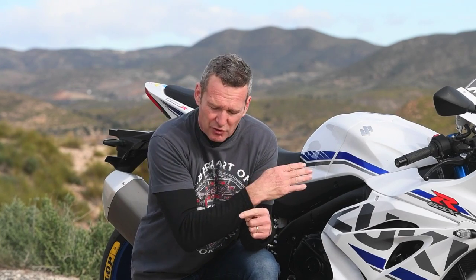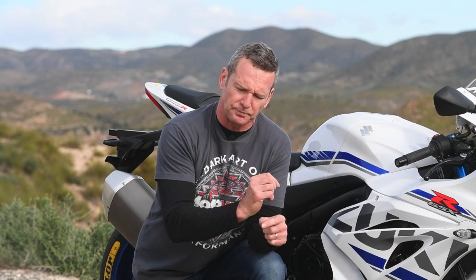I run Ohlins fork internals, a harder front spring between 10.5 and 11 — depends on tracks, my weight, and speed of client. On the rear, I run an Ohlins rear shock with the spring they recommend; it's been absolutely fine. I run a Brembo master cylinder without ABS, lines running direct to the original calipers, EBC race pads and their discs, and good race rubber. The only other thing I do is shorten the foot pegs a little bit to keep my feet off the ground — it's a cheap way of running instead of rear sets.